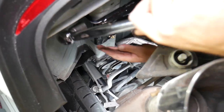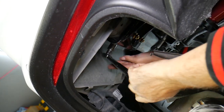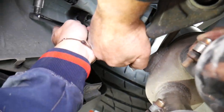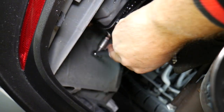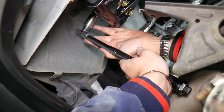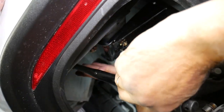We installed all bolts. Now we're going to get everything tight with the torque wrench. Our specific kit says 70 foot-pounds — always check the kit that comes with yours. When you hear the click, stop immediately; that means you've reached the torque and you're not over-torquing. Let's go ahead and do that, listening for that click. We'll do that for all eight bolts and then continue.